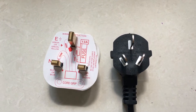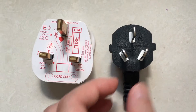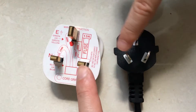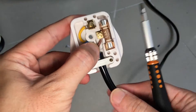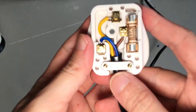One solution is to replace the China plug with a Singapore 3-pin plug. This plug is very easy to change and would make the connection a lot more secure and convenient to use. The original plug comes with earth, live and neutral, which means I will be connecting up all three wires to the earth, live and neutral prongs on the local plug respectively.